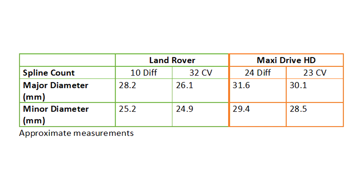The difference in material strength between standard 10 and 24 spline half shafts is actually pretty minimal — it was the design of the spline area which is typically where the failures occur. You can find a graph on Ashcroft Transmission's website showing breaking tests they did with the short 10 and 24 spline half shafts, showing that they both break around the same amount of force applied, although the amount of twist each can handle before failure is quite different. But by converting to aftermarket half shafts, you're getting far superior material strength and the stronger 24-23 spline combination.